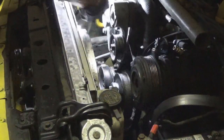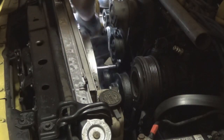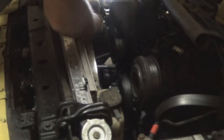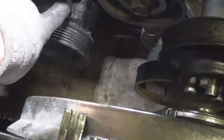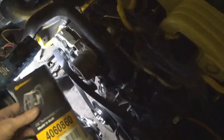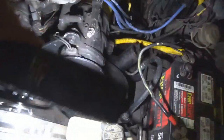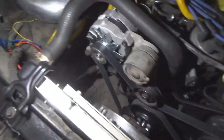Alright, now I'm going to take a ratchet and get that the rest of the way out — nine-sixteenths. The long bolt is out. Now I've got to get off that little bracket — it's hard to get the light on there and hold a camera and do all that. Battery level low — exchanging battery. Alright, this is the 86-inch belt instead of the 84.5 — I went and traded that in. We're gonna put this belt on. Everything will be turning clockwise except for the water pump.